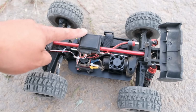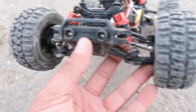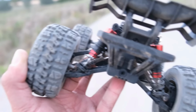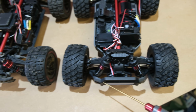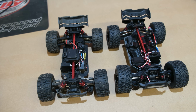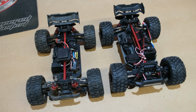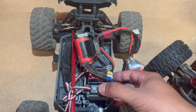Yeah, that doesn't work on the new ESCs, and it only worked on some of the older ones. Looking back, I think that ESC trick only worked on the H14BM. It didn't work on all of them, but I know there's still going to be people out there who will say, you didn't hit the ESC button 5 times. Now, what would happen is you hit the button 5 times, then you'd get 3 beeps, and then you'd be in the ultra crazy fast mode. Well, let me try it and I'll show you that that doesn't work.